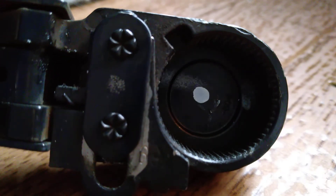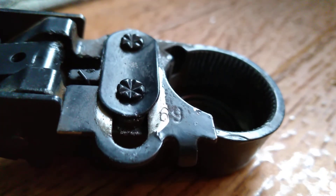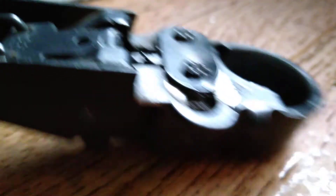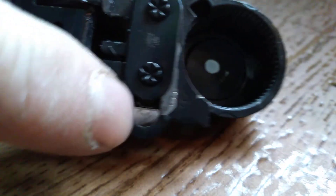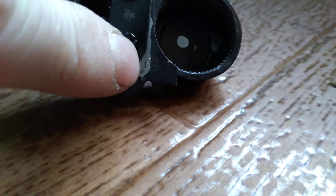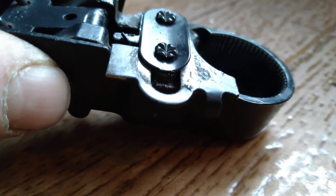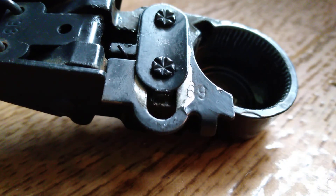When you remove it, pull up on your wiper arm a little bit until it stops — that will allow clearance here to slide this little clip down out of the way. Then you can take a flat tip and pry it away from your stud on your vehicle. I hope that helps and I explained it well enough. Good luck, keep going — 2021, bye YouTube.